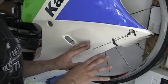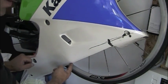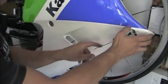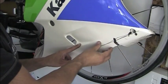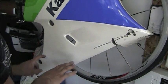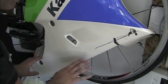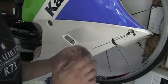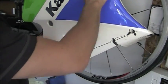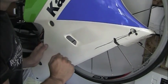What I could do as a trick of the eye is get perfectly matching paint — and I'll talk about that in a second — mask off this strip here underneath this duct, go from this groove here, mask this off all along the side here, and paint. First of all, repair this a little better and fill it in with some body fill. Sand it down smooth and paint this plane. The optical illusion is: even if there's a separation from where I mask and where it's painted, your eye probably won't be able to see it. And worse comes to worst, if I do a terrible job, I'll take it to my body guy and he'll repaint it, and he'll either mask off the factory decals or I'll hunt some new ones down somewhere. I'm going to do the same on the other body panel too.